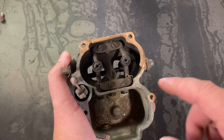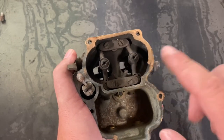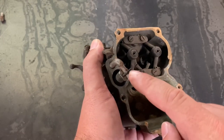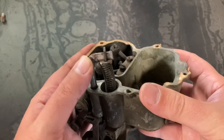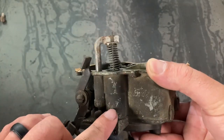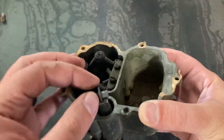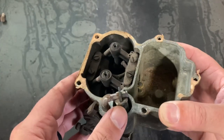But if we were to snap the throttle open like that, it's very hard for this system to keep up. Air is much lighter than fuel, so in order to compensate for that much air entering the venturi you have to introduce the accelerator pump system. The accelerator pump circuit is just a simple pump — fuel sits in this chamber here, and when you slam the throttle the pump pushes down and forces fuel out of this nozzle.